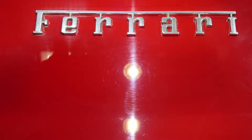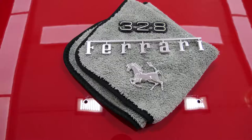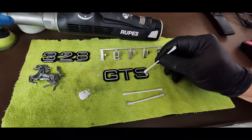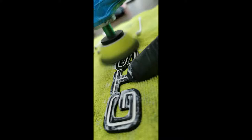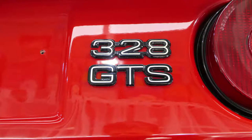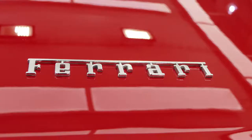Polishing between the emblems and the vehicle paint itself was also nearly impossible. That means this was the only and best option. The emblems themselves were then completely hand-polished and cleaned — first with cotton swabs, then with the small polishing machine — to prepare them for remounting. Only after the paint had been coated did we then mount them, glued or screwed, and the result is absolutely homogeneous and like new.